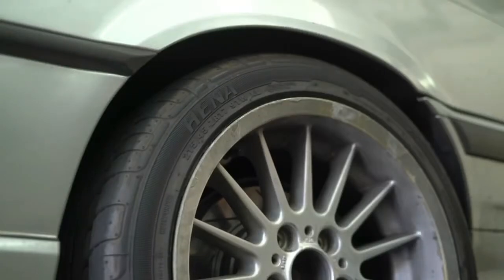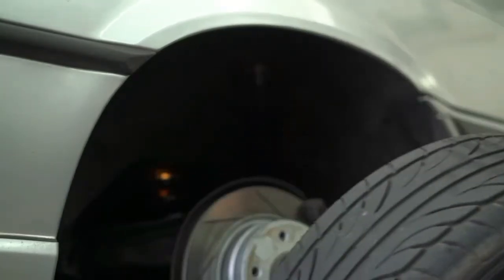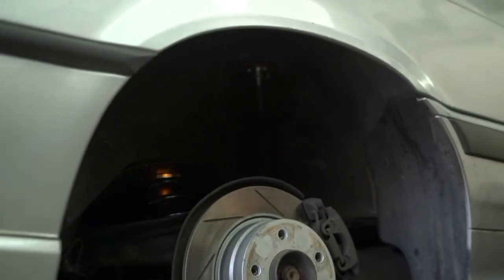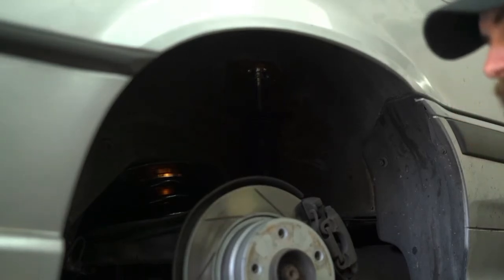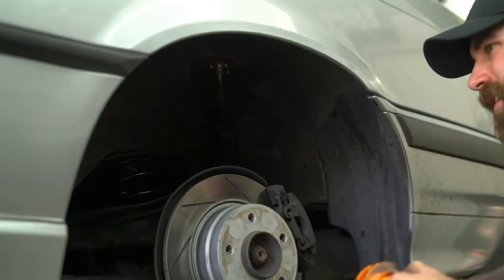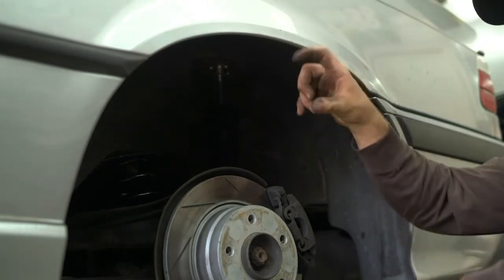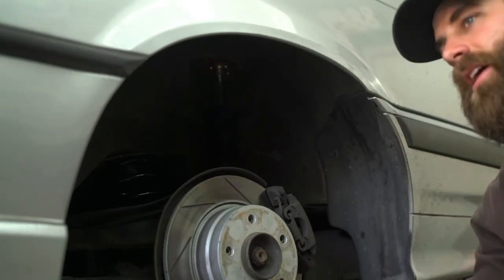That's at max droop. I've set the strut to have about 1 inch of thread engagement, which is probably the minimum you would want with a 2-inch wide strut. I'm fully happy with how low it would go in the rear. Not that I want my car slammed or anything like that, but the wheel gap was too big. The rear of it was just too high over here.